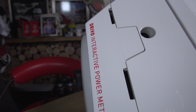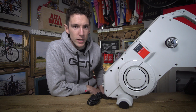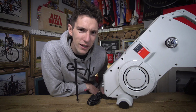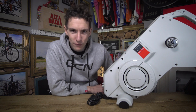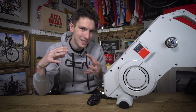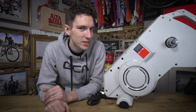You don't just have to take Elite's word for it, because they sent off pre-production units to the Physikalisch-Technische Bundesanstalt, which, if you didn't already know, is a lab in Germany that tests for these things, and they gave Elite a certificate. Yeah. The way the power meter works is absolutely fascinating because it does away with the more usual strain gauges, and instead it has a pair of toothed discs that sit on either end of the axle, and their orientation to one another is monitored by optical sensors.